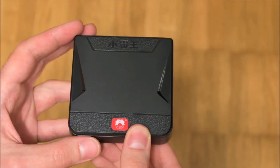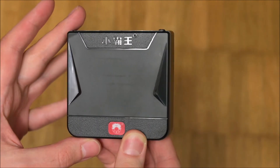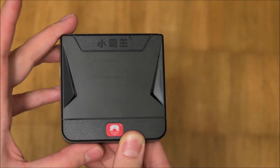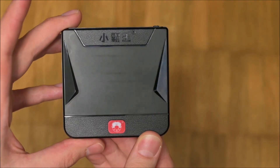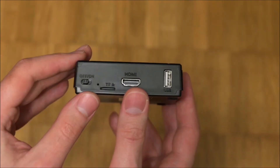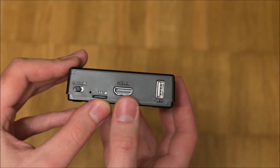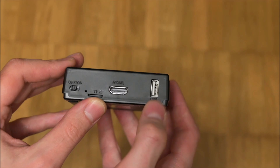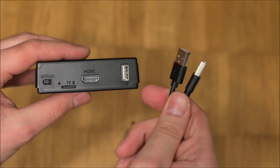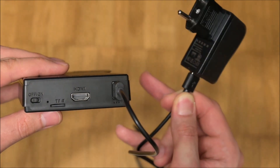The TWT-01 is very small, measuring just 9x9cm at the base and 2.6cm in height. The surface is matte, with the exception of two polished indents and two fake leather batch plates. The Chinese characters spelling out Xiaobawang are sharply embossed. The bottom is imprinted with model descriptions and power requirements. At the back is a HDMI video output and a trans-flash labeled microSD socket. At the left edge is the power switch. The device is powered using its USB-A socket via a non-standard male-to-male USB-A cable.